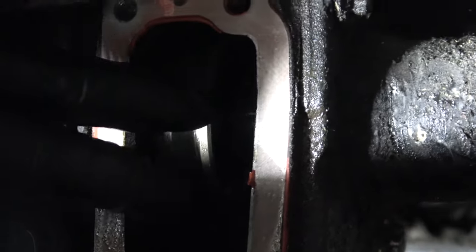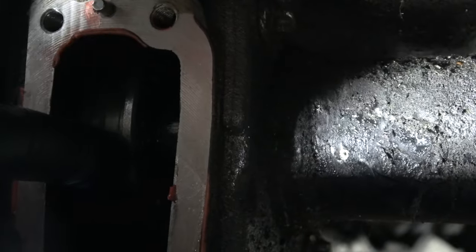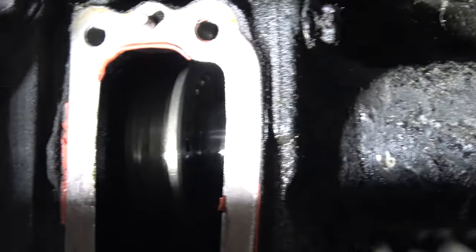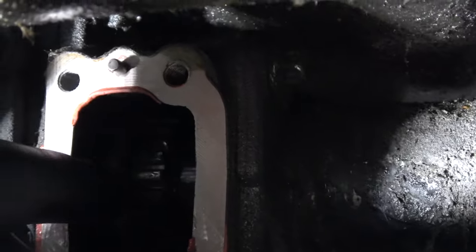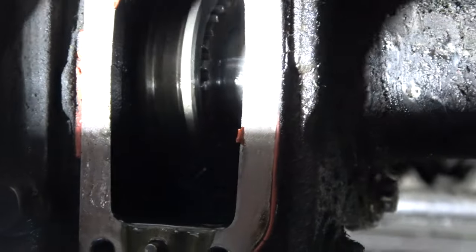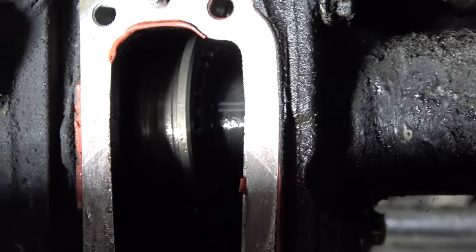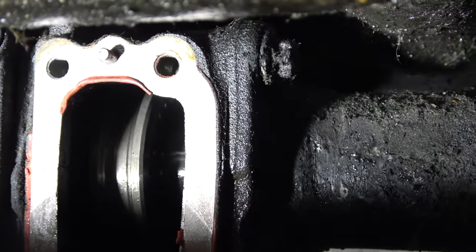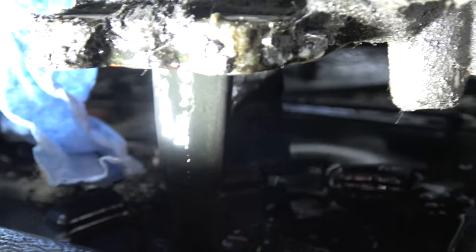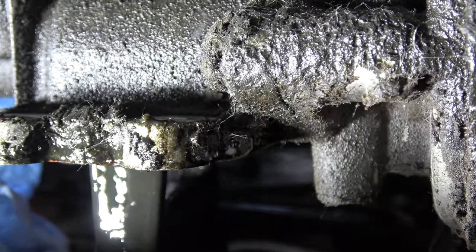When you put it into four-wheel drive, the vacuum system shifts this fork, and if you go in far enough you can see the gears. When you do this modification, you want to align the fork as if it's in four-wheel drive. If it shifts back too far, it's okay — you can slide it back in. Basically, you want to leave it in the four-wheel drive position and then adjust the fork to stay in the locked position, then do one modification to prevent it from sliding back to unlock.